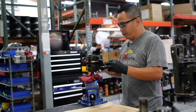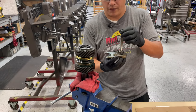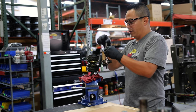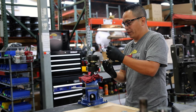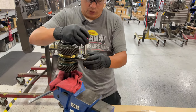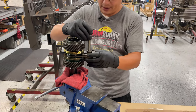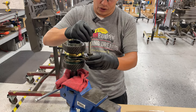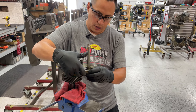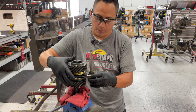The way this operates: this is the shift fork, which is attached to your handle with all the shift arm and everything — but this is what's happening inside. Every time you shift the handle back and forth, there are these two plates that push the middle upwards or downwards, which then engages the top or bottom gear.